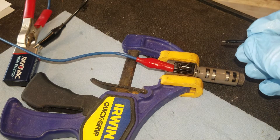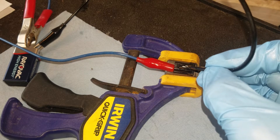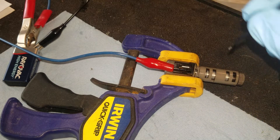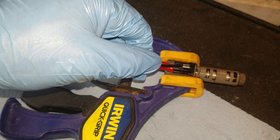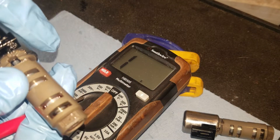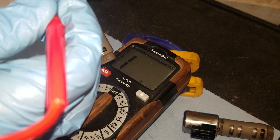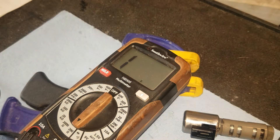This is the new one I've ordered, set up the same way with positive and negative. Touching the positive — you can hear the audible click and see the solenoid move. To further test, I'm checking the ohms. It doesn't matter which lead goes to which — one to positive, one to negative — reading 5.8 ohms, which is actually acceptable range, though the old solenoid was also bad.